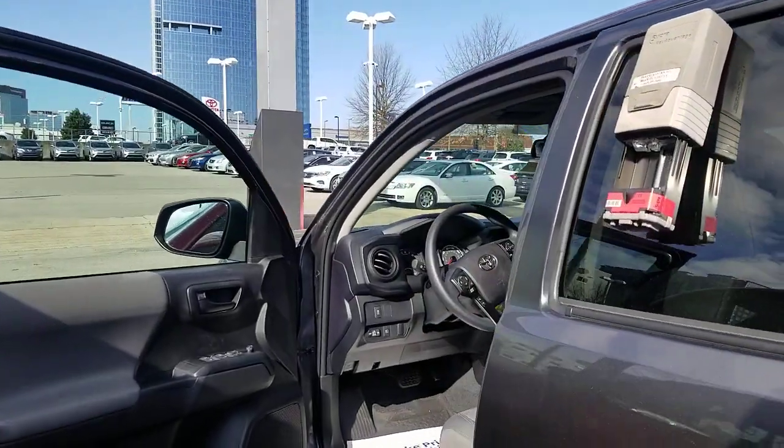There are actually a few other cars you can do that with. The Tacoma is the only one I've noticed that has that button like that — I'll show you on some of the other vehicles coming up. That way you're not driving with the tire light on when you've changed your tires and you know you're at the pressure you want. That's how you set that. Steve Walsh, Bima Toyota — definitely like and subscribe. Take care, we'll talk to you soon.